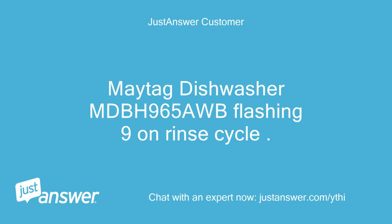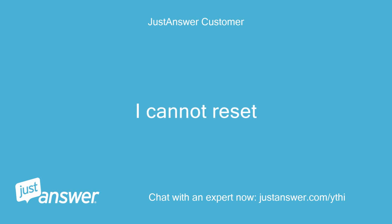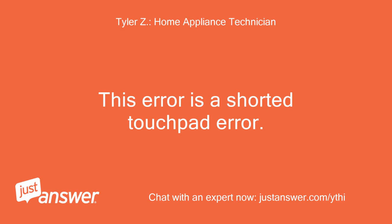Maytag Dishwasher MDBH965AWB flashing 9 on rinse cycle. I cannot reset. This error is a shorted touchpad error.